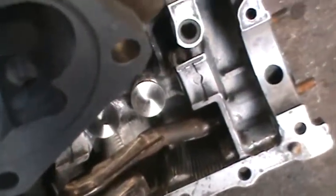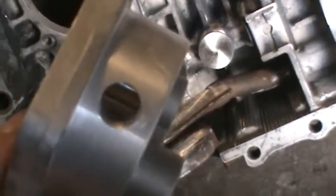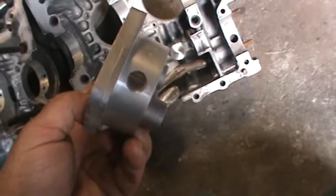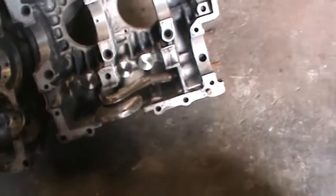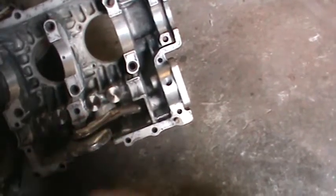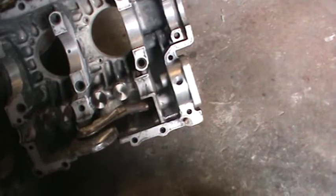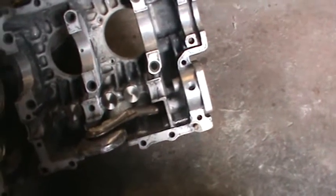You can see down in there, the hole's been done. We did the top, cleaned up the little cavity there, and we did both sides - cleaned that side up also. Haven't decided whether we're gonna full-flow this or not, so I don't know whether to plug this or tap it. I think we're just gonna go standard. Next I'm gonna check the end play on the cam, put the bearings in there, the oil pump, make sure everything clears - the gear clears and the bolts aren't hitting.